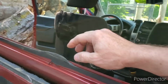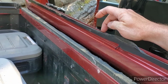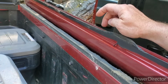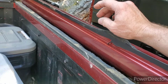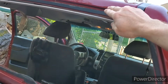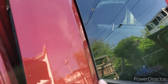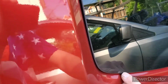And if anything, those plastic standoffs that were underneath the window, you want them sitting on top of the metal, not anywhere behind it. So the very bottom edges of them need to be on this. That's basically where to set it. So you need to be very careful about your sides. Make sure you have an overlap on the top, because really the glass fits in here in a very flush fashion. Like if you look at these suicide doors, you can actually see that there's just a very thin gap. So that's what I'm looking for.